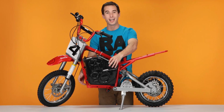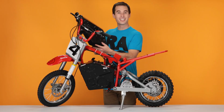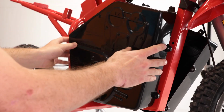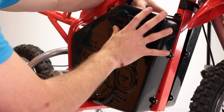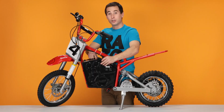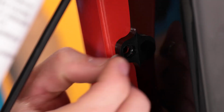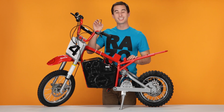And put the cover on, lining up the holes. Now take the right side of the battery cover and place that on too. Align the 2 sides to each other, and then you can bolt them together. You probably dropped a few of the nuts while removing it, so now's a good time to put them back in. With your 4mm Allen wrench, tighten the top 2.